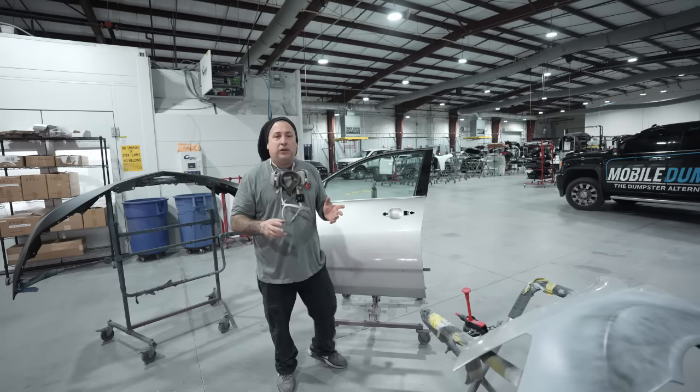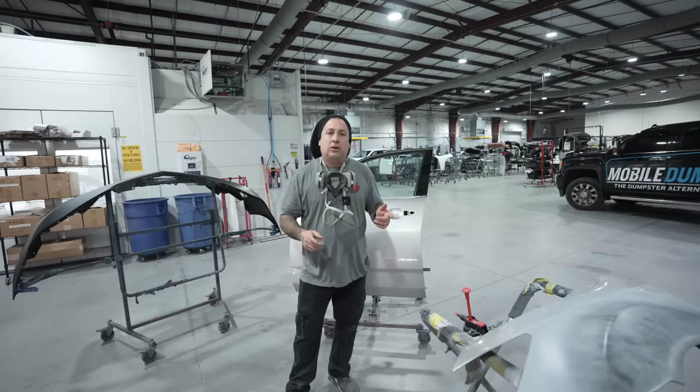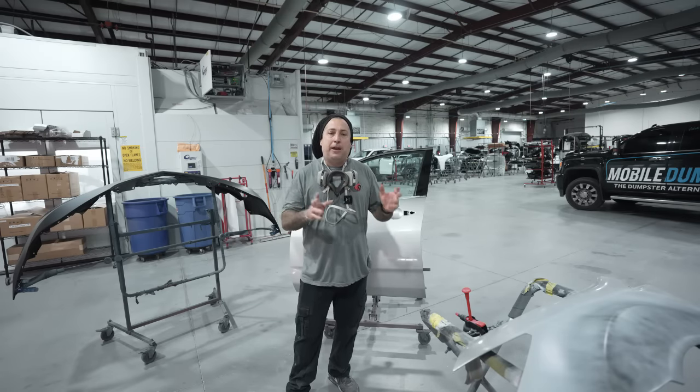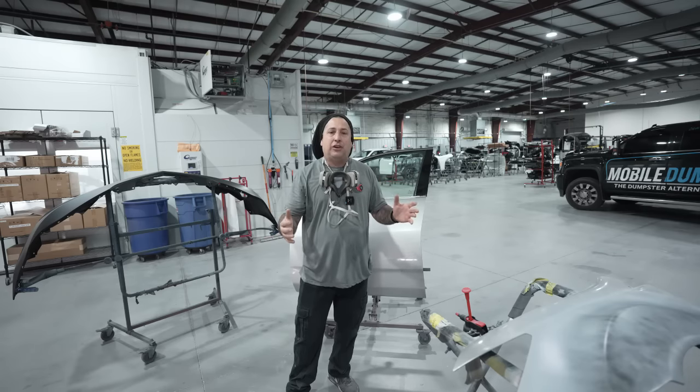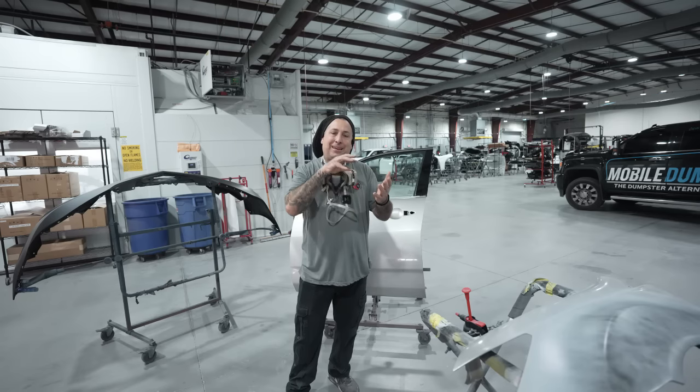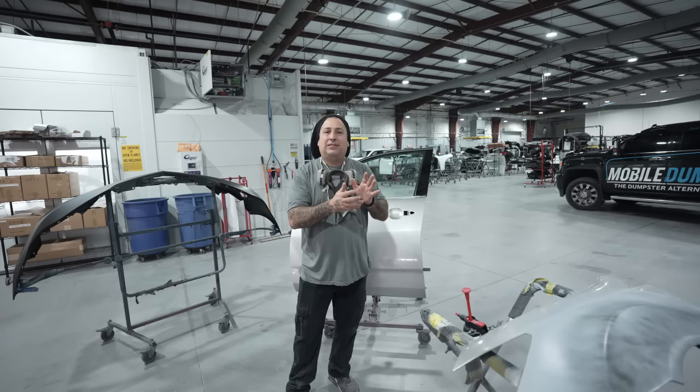I've seen a lot of guys through the years go over to a part of that vehicle that isn't even in the area that you're going to be painting, not knowing if that panel had been painted, and you want to get that camera, to me, as close to that area that you're going to be painting, because cars will fade depending on the location of that vehicle, where it's parked. Maybe the person works out in a certain area where they have half of that car shaded by a tree. I want to make sure that I'm taking that reading right on the money where I'm going to be putting my color, because as we know, when you used to have the chips, there were variances based off of where that car might have been manufactured.